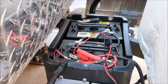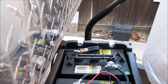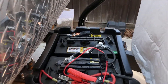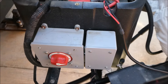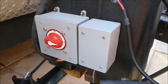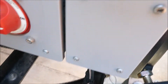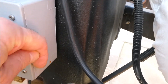What I'm going to do right now — the solar panel, the 200-watt Renogy system, came with these clamp-on deals here. I'll be taking those off and this panel-mount SAE connector is going to replace those. I can get my 12 volts inside this box right here. I put a battery disconnect switch on here, and in here I've got switched and unswitched 12 volts, and I put a nice ground stud right here. The positive wire is inside that box and I'll probably attach the panel mount bracket right here.